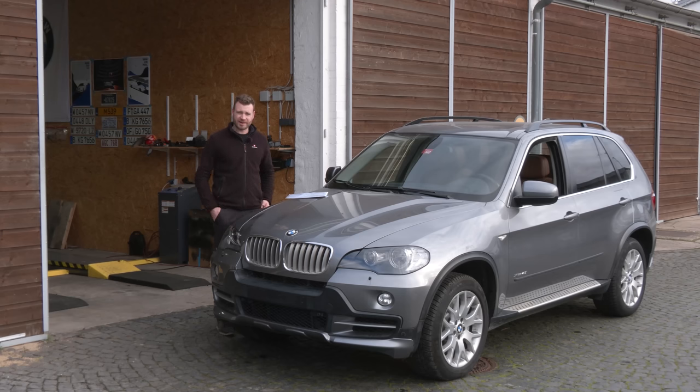Two reasons for that. Number one, it had worn out valve stem seals, so it was burning and smoking oil, so he couldn't pass the sniff test. But number two, and sort of a bigger issue for someone who doesn't know what they're doing, this car was imported from Dubai and it's Middle East spec. It was sold brand new over there.